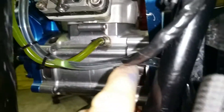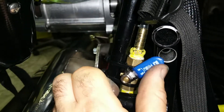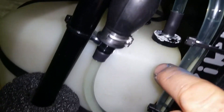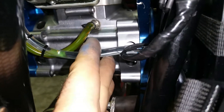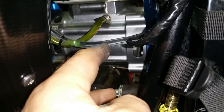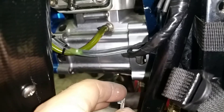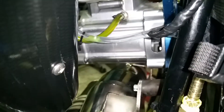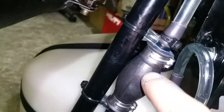I've also done the fuel shut-off valve. This is the fuel intake line — it comes to a valve I can turn on and off. Right now it's on, going to my primer and then to the fuel tank pickup line. What I've omitted here is an inline fuel filter, which I'm going to insert once I get a new one. I kept looking at local stores but couldn't find a small, good-quality fuel filter — those available are paper-made filters for lawnmowers. I don't want to use those; I'm using 94-octane gas and synthetic oil on this machine.